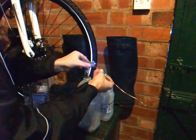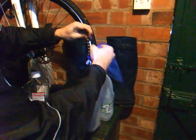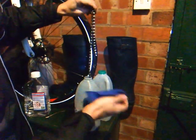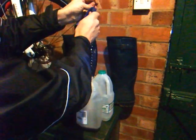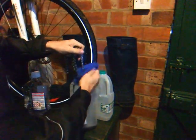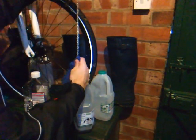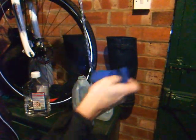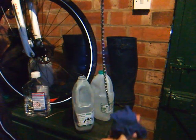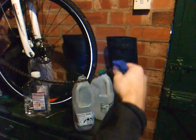Already you can see the chain is quite shiny. Just get the cloth and give it a wipe as it's coming out. What I'm doing is clearing off some of the white spirit and muck before it goes into the next container. This first one was to get the initial muck off, and the second one is clean white spirit for the second application.